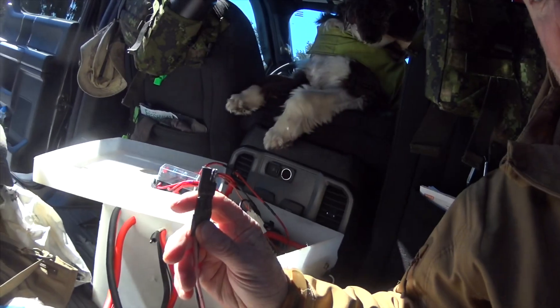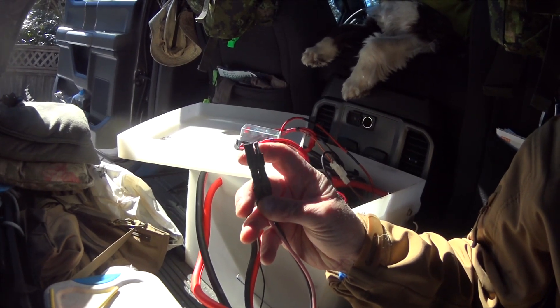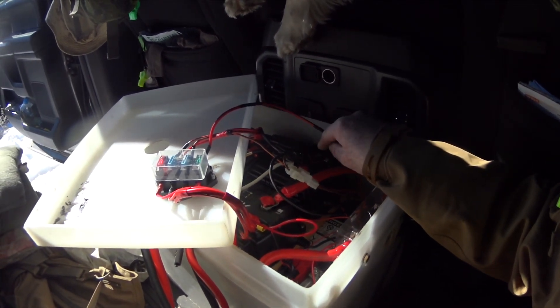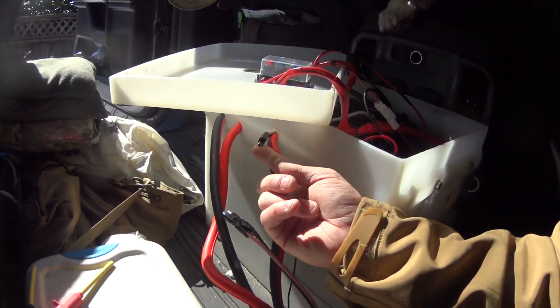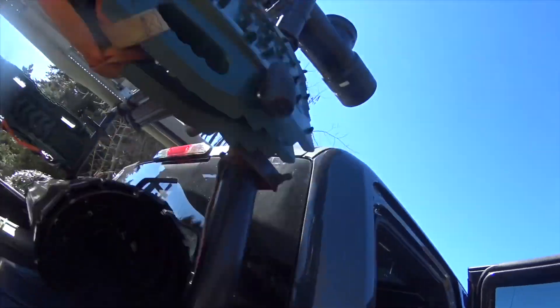So now I had to go back and check the wiring from the solar panel, check the solar panel, and all connections between there and the D250SA. Starting off at the box, this connector here is from the solar panel directly — the positive and negative. This wire here is from the D250SA going through the box to the connector. I designed this box so it could be a quick disconnect. Testing from here back to this connection was good with continuity. I then did a continuity check from this connector all the way back to the solar panel and it seemed to be all good.